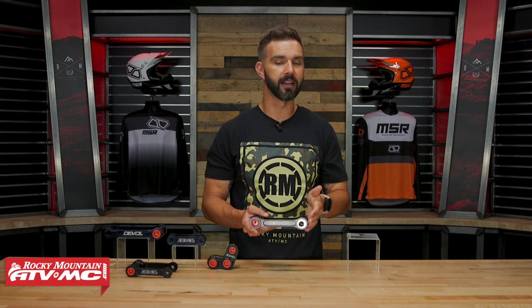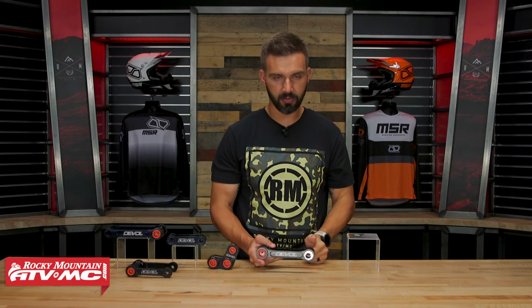So they say goodbye to rear end wallow, and what they mean by that is when you're accelerating hard on the gas, the bike's going to want to squat a little bit just because it's under load, and sometimes while that's happening, your rear end feels kind of vague, going side to side. This, they say, can really help with that. And same thing with the lowering link, where it can help also with that front end stability. But that's what's unique about the Transformer Pull-Rod, is that you have adjustability and you can fine tune and find the setting that's going to work best for you.